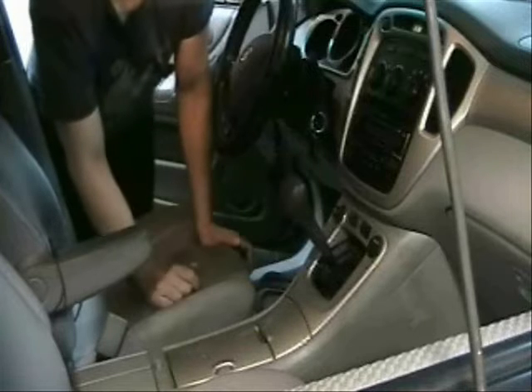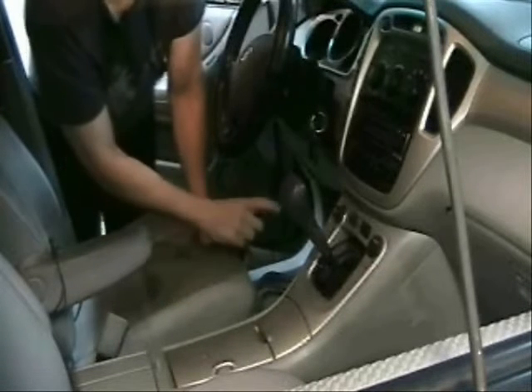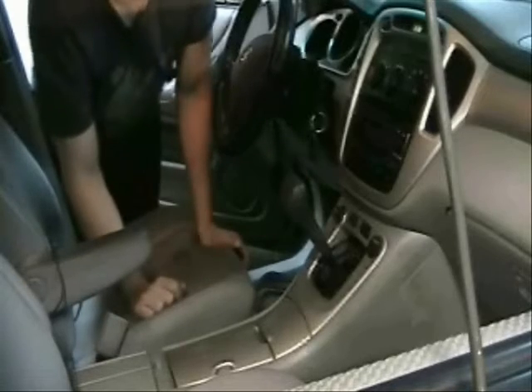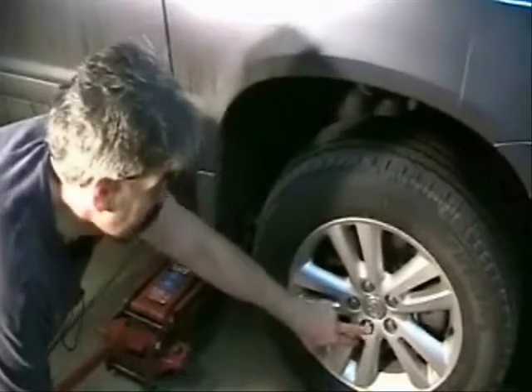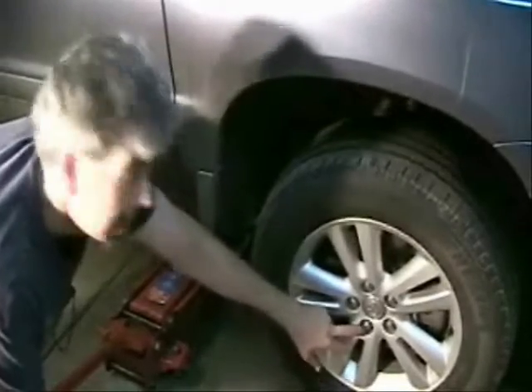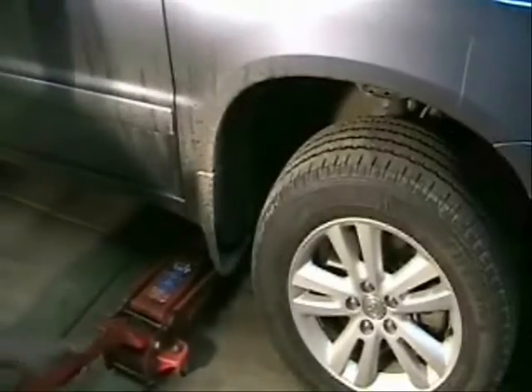Apply your parking brake, and then put the gear selector into neutral. You'll probably need the key in the car, or maybe hold down the brake pedal slightly to move into neutral on an automatic. Break loose your lug nuts unless you have an impact gun — just break them loose, don't take the nuts out, and then jack up the car.